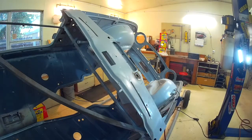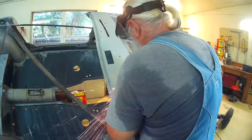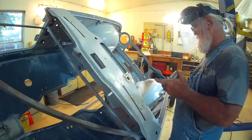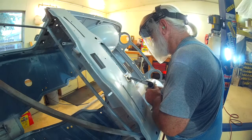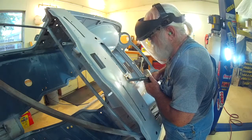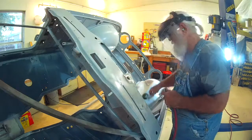I'll be using the wide cutoff wheel and then that little belt sander — rapidly becoming one of my favorite tools. It uses up belts fairly quick, at least for what I've been doing with it, but I like the way it grinds: it's smooth and fairly easy to control. It does a different scratch pattern than the wide cutoff wheel, so it makes it sort of like a guide coat — I can use one, dress it with the other, and then go back and see the high metal or low metal as the case may be. And it keeps from cutting away too much.